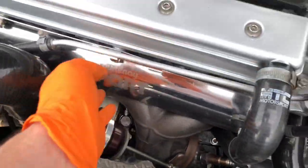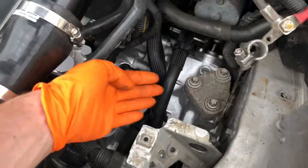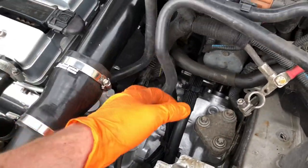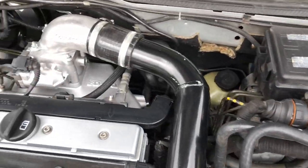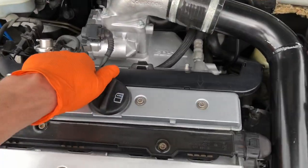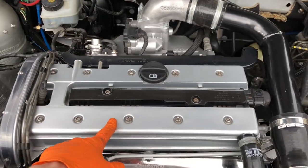I've got the Courtney Sport heat shield on there now. We've got to bleed the clutch - that's why I've left the battery tray off. Brand new pipes and everything in there, that's going to be covered up anyway. The boost hoses and everything are on so we're really ready to get this turned over and it should be running soon. I've just got to go and get some oil because I've got none. I've put fresh plugs in there as well.